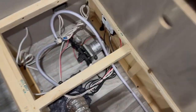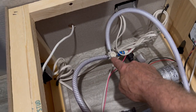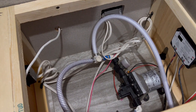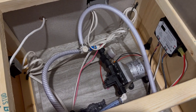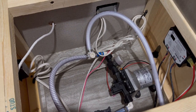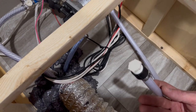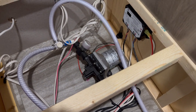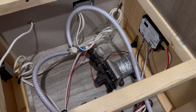My RV also has a valve I have to throw in the fall to winterize. I have to throw this valve right down here — you can't see the lever, it's facing away. But now we do want to turn that on, because we want to make sure that the pump, when it's turned on, will be able to draw water from the tank. If we didn't do that, it would still be trying to draw from the accessory hose we use to put in a five-gallon bucket with our RV antifreeze.